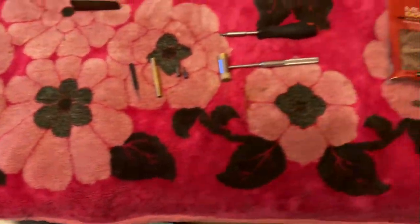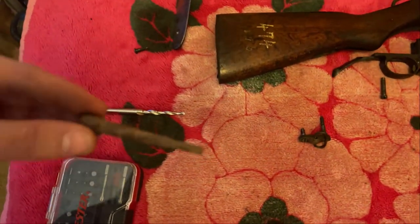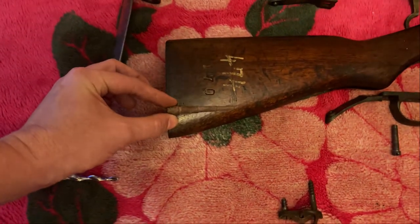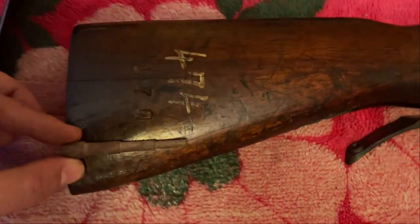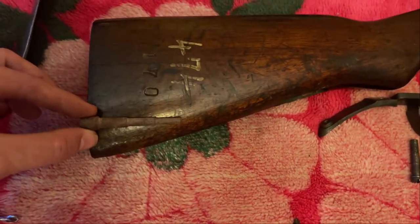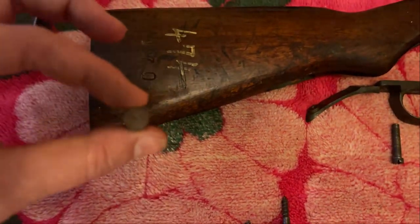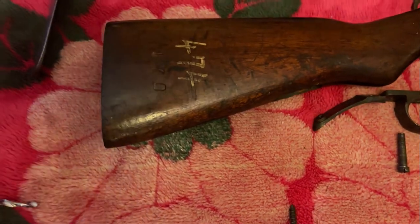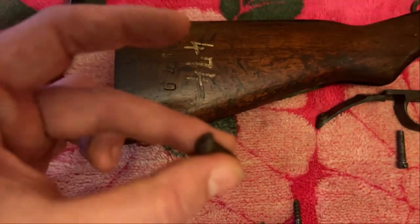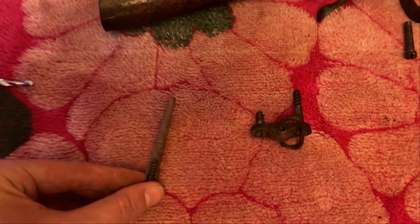And then I'm going to Acraglas the hole ever so slightly, and I'm going to put a thin layer of it on here, and then we're going to drive this in flush, or just about flush. I know it looks like it's going to break through, but it's not. So I'm going to replace the entire bit of wood, and then drill a hole in the middle of the new dowel, the diameter ever so slightly smaller than the screw of the rear butt plate, and then feed it into here. And it should become a permanent fixture.